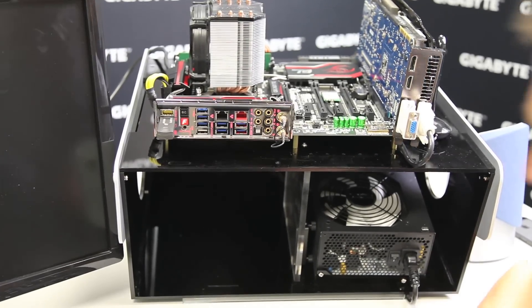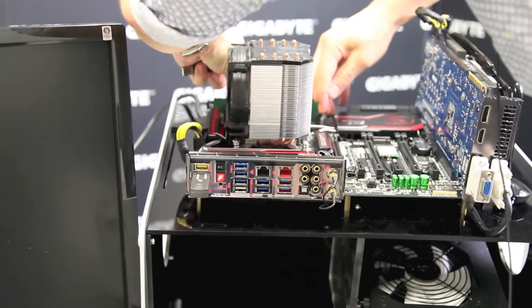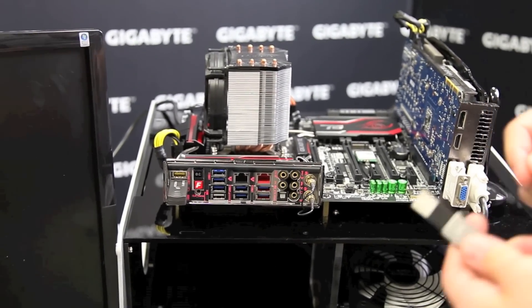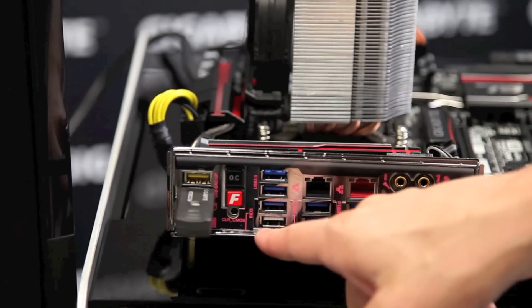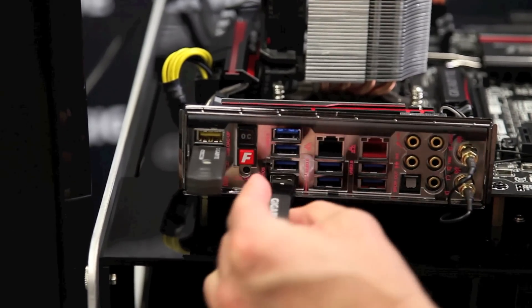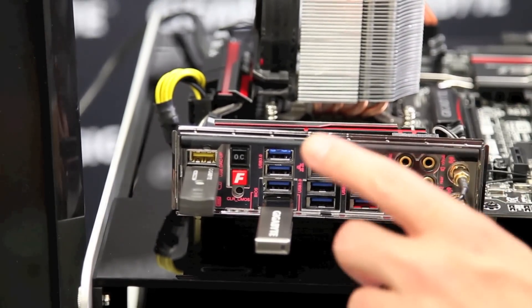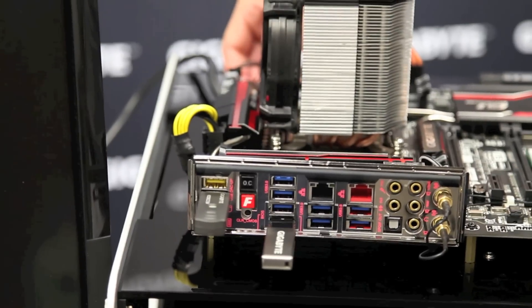So now the system is shut off and the memory is out. I'm going to put my BIOS file in this special USB slot right here. As you can see it's a normal USB slot but it's coded white, so you can see that it's a different slot than any of the other ones. I'm going to put that in, turn on the system, and then it's going to automatically flash. Watch this area here because we'll actually see the LED flashing on.